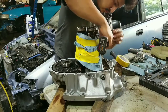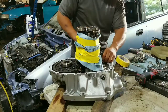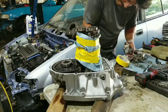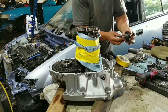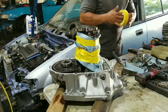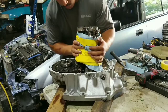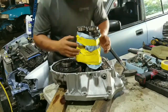There's one bolt. There's the other. This shift selector comes off, just two bolts there. And then the shaft for reverse and the actual gear for reverse comes out there. So once that's done, move this back down, put another round of tape down at the bottom. Tape won't hurt it, so the more the better. And this should just pretty much wiggle out. Should. May be too tight, but we'll find out.